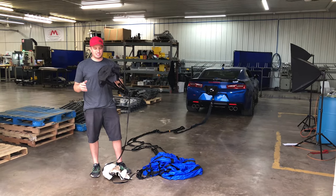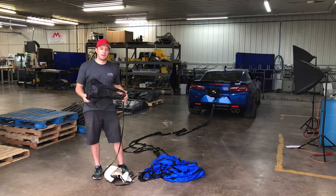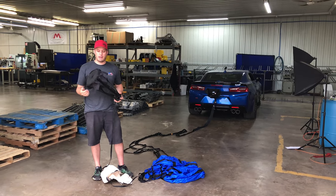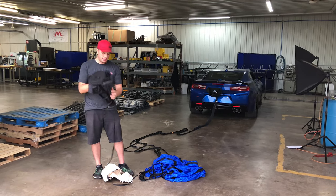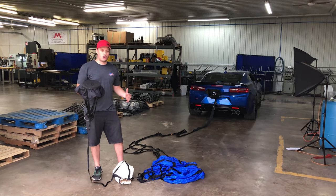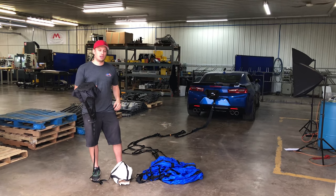This is called your spring pilot. The parachute we have on the Blue Mule is a spring pilot parachute. What it is, is an actual spring — when you pull the cable, the spring deploys. This is actually a mini parachute in itself, so this is going to catch wind and pull the rest of the chute out of the main bag. On other cars, you'll see air launchers that won't have this part; the air launcher actually rockets it out on its own, same with a spring canister launcher.